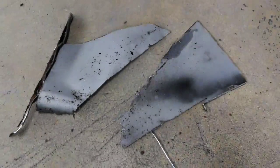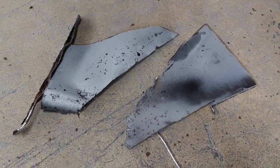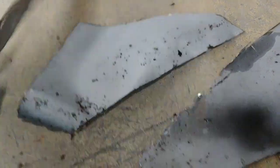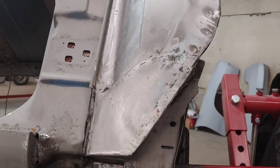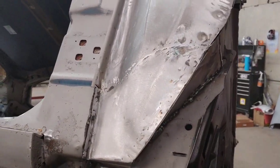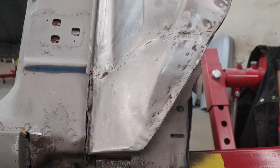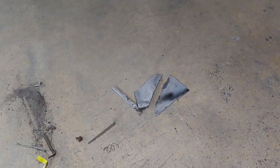Kevin here from Harrington Classic Car Restorations. This is part of the 70 Chevelle cowl sides that we replaced this evening. As you can tell, that stuff's full of rust, full of rod holes. This is the front piece that we fixed, and that's what we ended up with. We'll sandblast the welds, then fiberglass the welds, and treat the inside with some undercoating to help protect it. I did treat the inside with some 3M weld-through primer, and we'll be ready to go. Stay tuned for more.